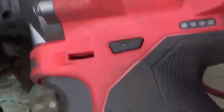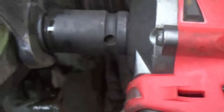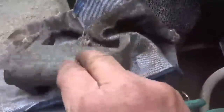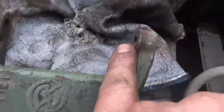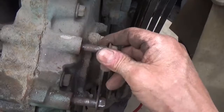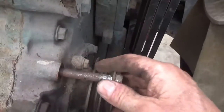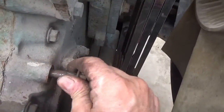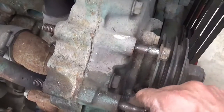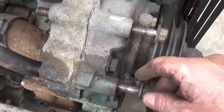I can't tripod the camera where I'm at, and I don't have time to deal with that. Got that thing off of there. The bracket's sitting over here and it's not in too bad shape — it needs to be polished up a little bit. And the gear cover — this is the back gear cover, this is the front half of the gear cover. That's all the timing gears inside this thing for the engine. That's why it's not easy to fix this problem. The bolts have worn this out, and I don't know why — I guess they got loose and I didn't know it. It's a common problem; all these Detroits seem to have trouble with this.